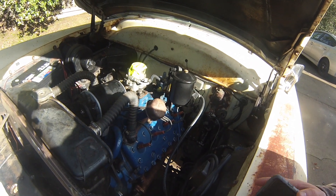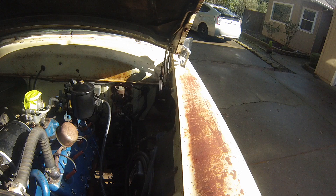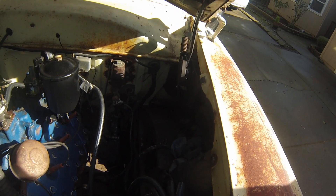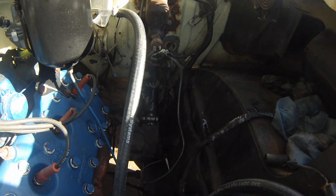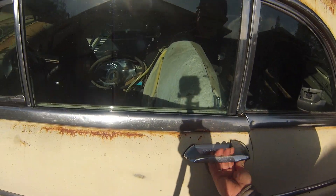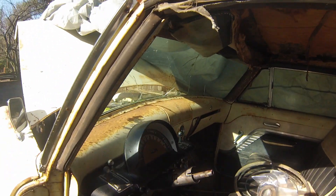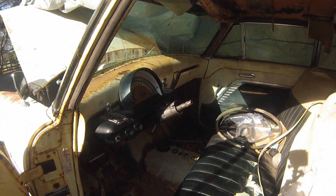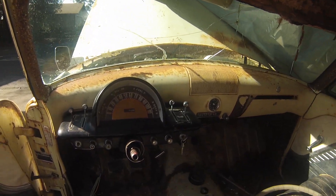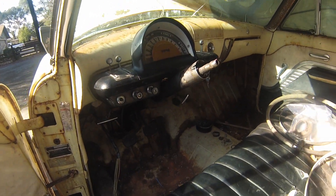So off comes the head, off comes the intake manifold and the new alternator, and then I'll pull the valves out. I also cleaned up the steering column — I pulled it all apart because the shift arms were lock solid and all gummed up. The reason I took it apart was because the shift collar — the gear socket on the three-on-the-tree, where the pin goes in — broke off. I have that at a machine shop; he's going to try and fix it because the part availability for a new one is non-existent. So I have to get a used one or have mine fixed.